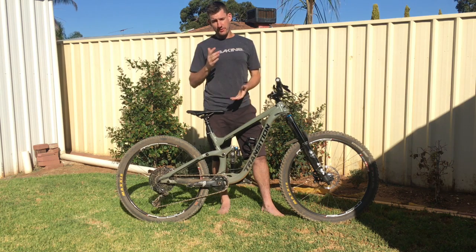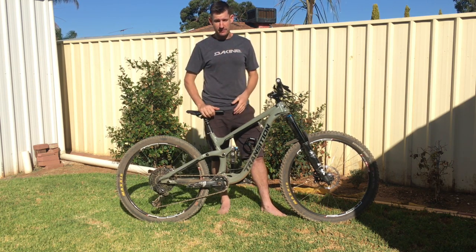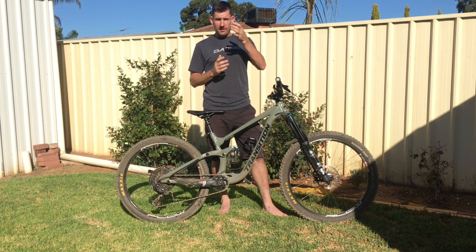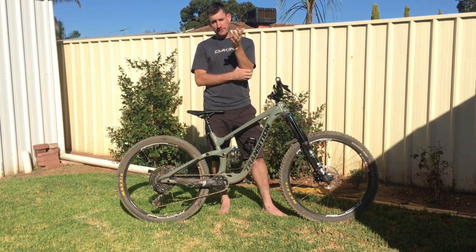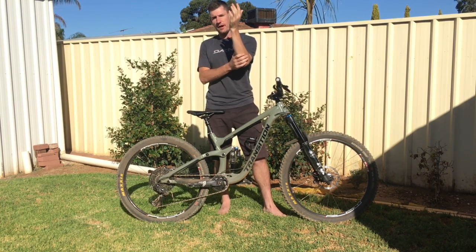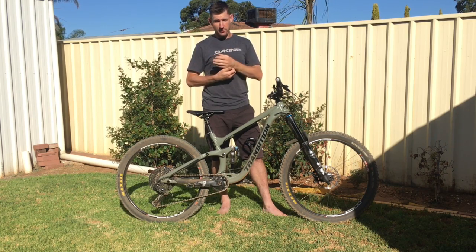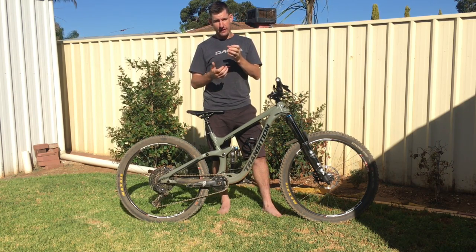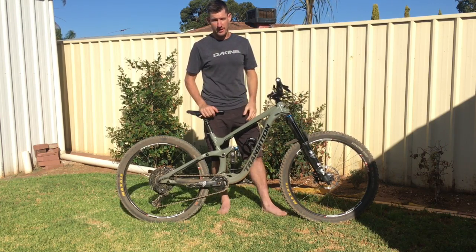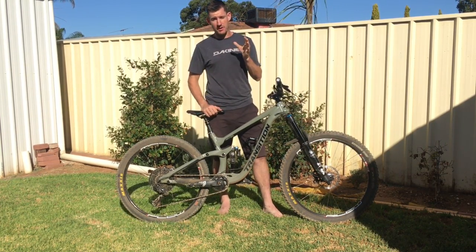I was finding with the spacers, regardless of what spacers, it was getting less abrupt as I was going to smaller spacers. But I was definitely finding that because I was having to run a real deep sag and real soft off the top, it'd go in and then it'd get hooked up on things - so it wasn't a consistent, efficient use of the travel. It was using heaps at the start, and then very resistant to use travel at the end, because there really wasn't much left. This is using the travel much, much better.